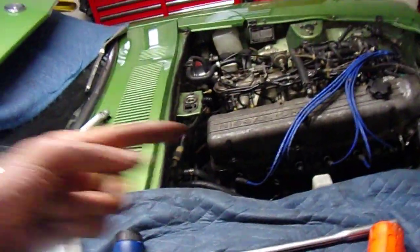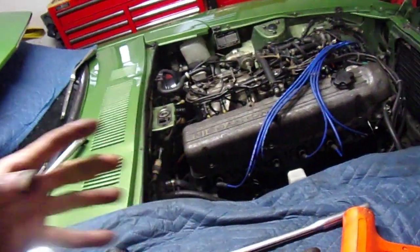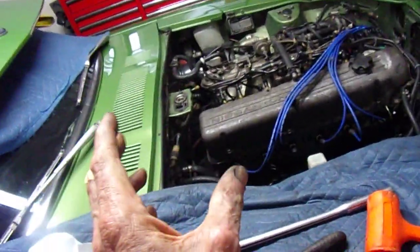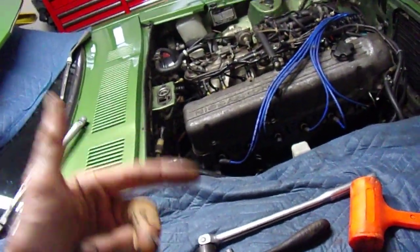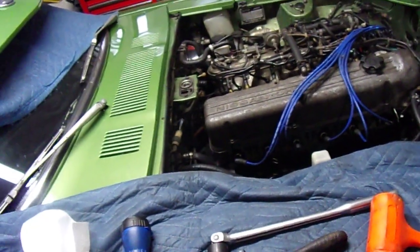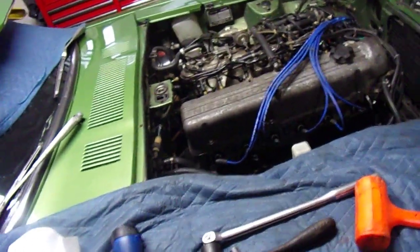Like I said, those guide pins that mount in there help to clock the transmission. Once you get them in, they stick out like three inches. So before the input shaft is even getting near the pilot bushing, those guide pins have already got you clocked and aligned 90% of the way. So just a little bit of shaking, and usually you get right back on there.